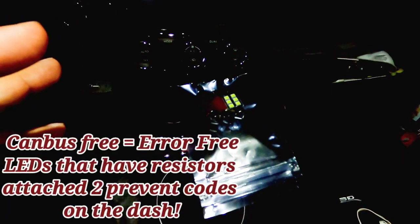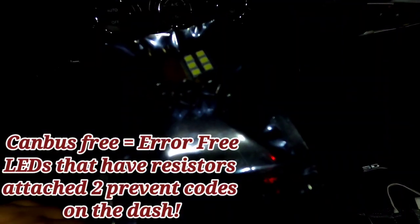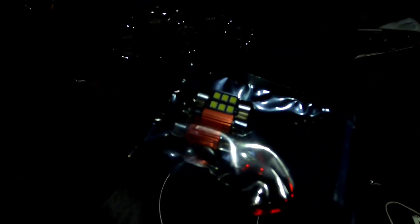Now guys, a couple things to note. To be fair, the Yorkim, the C Light, and the MarsAuto, none of them threw a code, so it was CAN bus free. Also, all of these bulbs were non-polarity sensitive, so you can put them in and it doesn't matter the orientation, the bulb will still work. The C Light and the Yorkim lights that I had before were 6000K. The MarsAuto is 6500K white and 300 lumen. They did not state the lumens on the C Light nor the Yorkim. So at least we have some type of gauge of brightness on the MarsAuto.